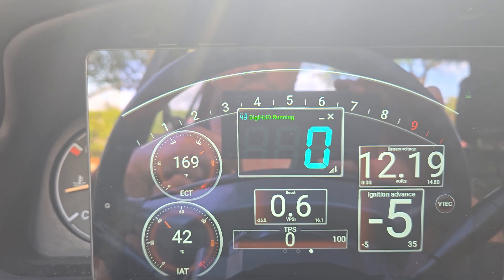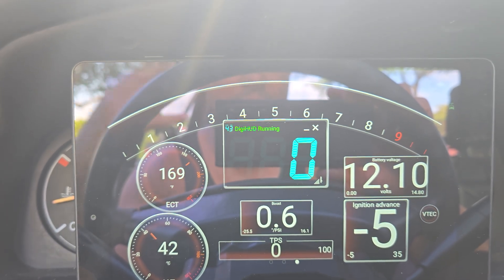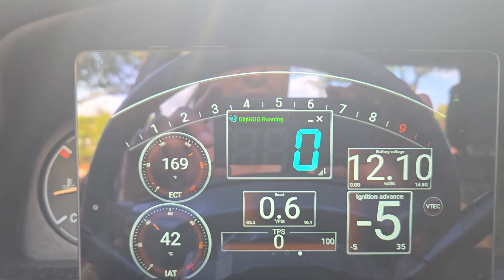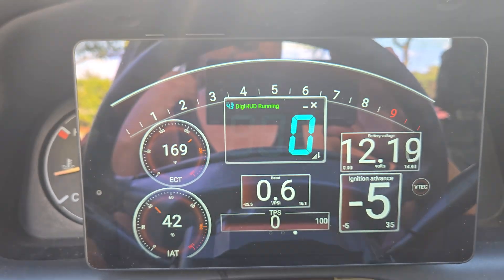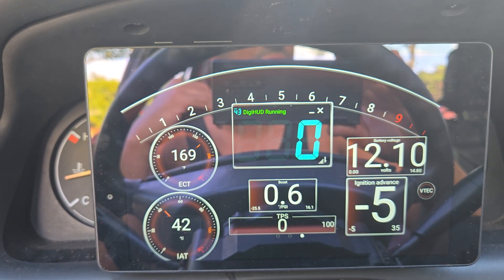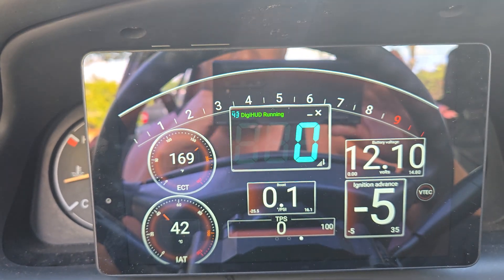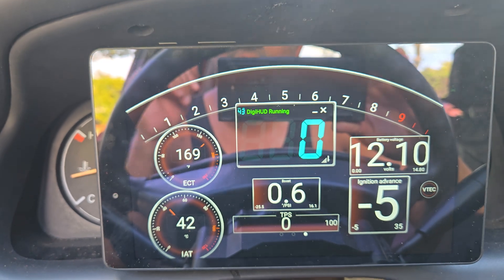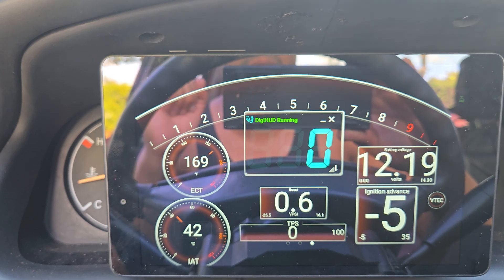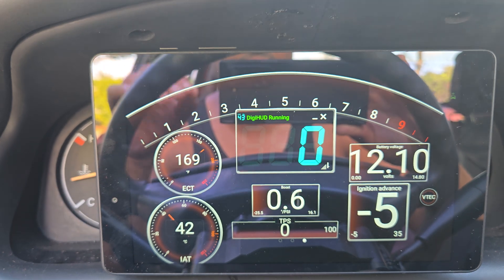That gets better dyno numbers. Plus the car is nice and hot, but the engine itself is not too hot, and the coolant itself is not too hot either. But just remember your coolant reading is never what your engine really is — it's just pulling heat away. So that gives you an idea: if you're driving a Honda Civic and you're at 215 degrees, and your motor's operating range is between 200 and 220, your engine is actually probably in the 220s. That's why I like to run typically a little bit cooler so I know the engine is not as hot as I think it is — gives me peace of mind.